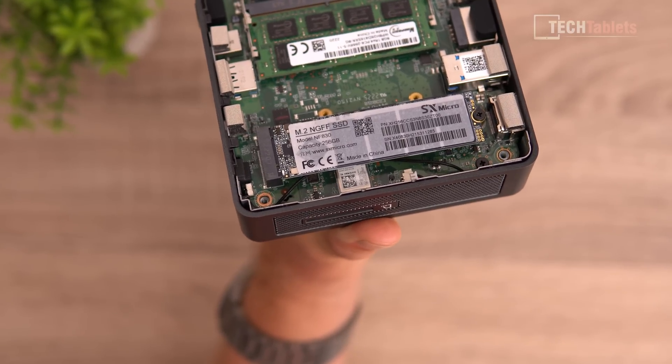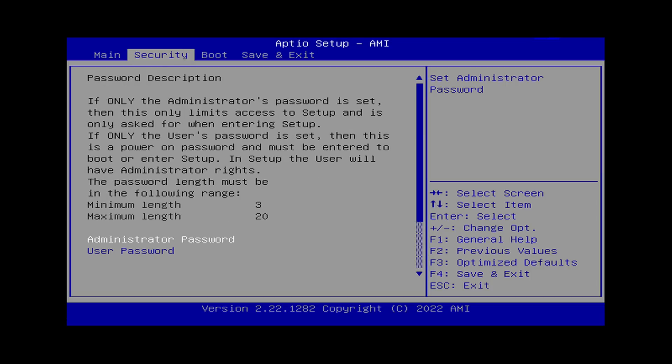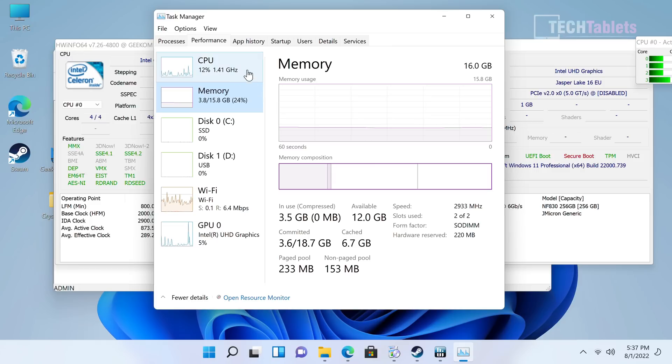The wireless card is Wi-Fi AC — an Intel 7265 — so unfortunately there's no Wi-Fi AX. I would have preferred the Intel AX200 or AX201, which is of course much faster. Looking at the BIOS, it is pretty much completely locked down with no advanced settings, so we cannot tweak or change power limits. The Mini Air 11 is now running RAM in dual channel, so my performance figures will be slightly better than stock.